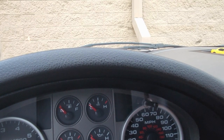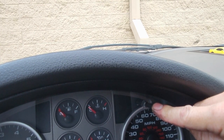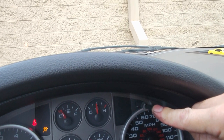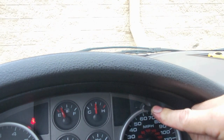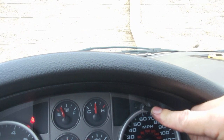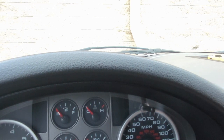My foot is on the brake, I'm holding this down, and I do two clicks on the key ignition — one, two. Just keep holding it down and the brake. It says 'test' at the bottom. Done. You just wait for the test to go away and it's reset. Then turn your key to off and start it right up.